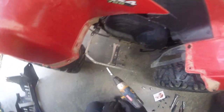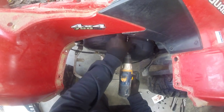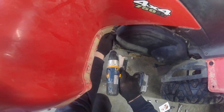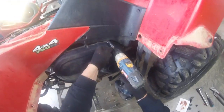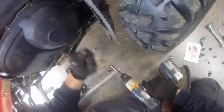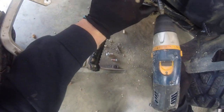And then that's where we're at right here — this is all 8 millimeters. Just unscrew every one of them. There's no editing in this video, so this is more or less how long it'll take you to take the transmission off — you can account for about five minutes here. As you can see, I've got nearly every screw out of this, so you'll have them off pretty quick too. It's not a big deal to take one of these transmissions off.